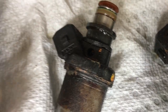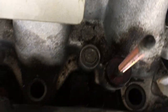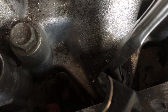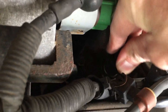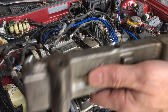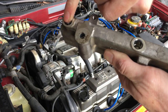That one's too filthy. You can see the OEM ones say Japan and both have that logo with a K on it — that's how to tell the new ones are OEM Honda parts. Notice the lower O-ring: the ones on the old injectors stayed in the intake. I'll get those out with some needle nose pliers — two, and three. Now get the new injectors and press them in place nice and snug — two, and three. Now onto the fuel rail where the tops of the injectors go in. I get a little spit on my finger and wipe it around the inside of the hole — that helps lube things up so the injectors go in easy.